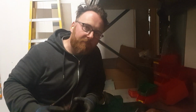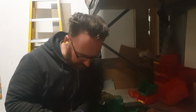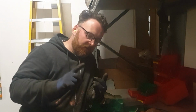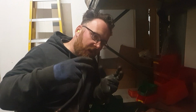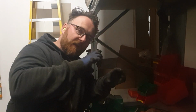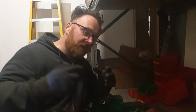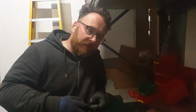Alright, making repair panels. Up until this point, we've really not had to do this on Tools and Track, mainly because everything's either been glass fibre, not rotten, or so rotten that we've just binned it. What I'm going to do is get a length of cardboard, line it up, fold it around where that chassis leg is, and use that imprint to cut out and make a very rudimentary template for the length of steel I'm going to need. I'll skip to the end.